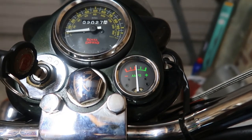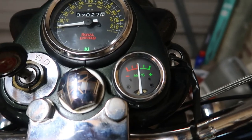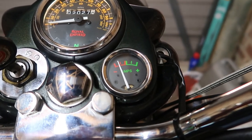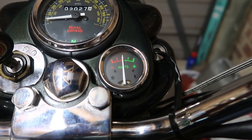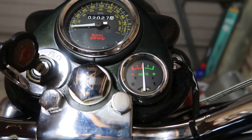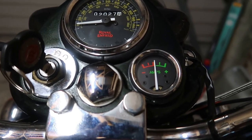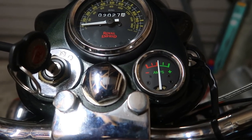Okay, so there's the finished product. If I turn the ignition on you'll notice a slight deflection into the red zone — not very far — but if I put the lights on it deflects over further. So when you start it up that should then go back into the green, which shows that it's charging. If it goes over to the green side when you just turn the ignition on, then the two wires as I explained earlier — you just need to swap them round and it will show red rather than green. But it should go into the green when you start it up. Thank you for watching and I'll see you in a future video. Bye.